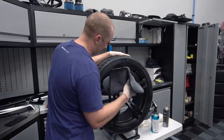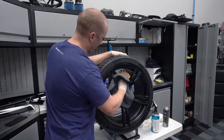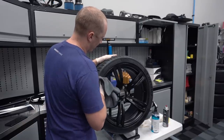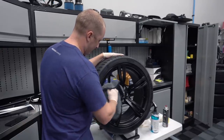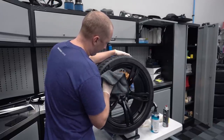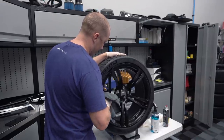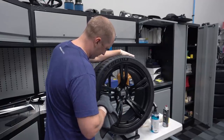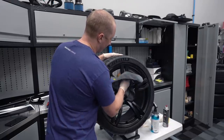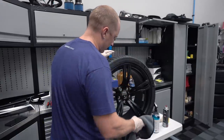If you were doing used or older wheels and preparing to coat, you probably wouldn't be able to just simply wipe down with eraser - you would probably have to get a clay bar out and really prepare, maybe do some iron removing as well. Since these are brand new, all I need to do is make sure all the oils are cleaned off - especially from that tire spraying - and there's a bunch of polish on them from applying the M101 during polishing the car.